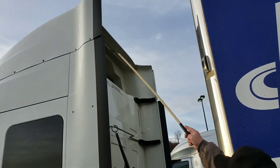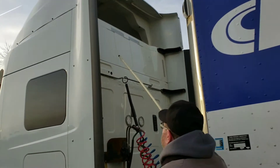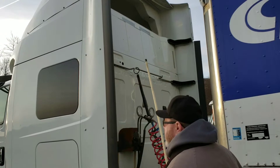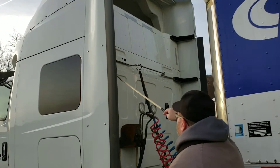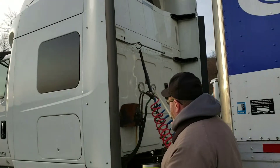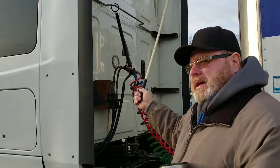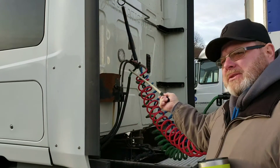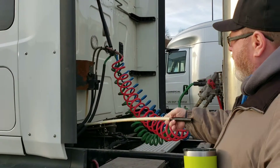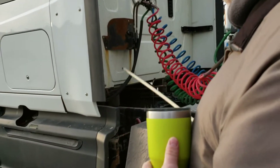You have your air dam up here — you can call it whatever you want, just say top of the truck, it's secured. This is DOT reflective tape — it has to be 50% if it's on the truck. You have your accessory bar going across, used to support the airlines, they're in good shape. These working lights have a switch inside — at night that turns on so you can see while you're connecting your hoses. All your glad hand connections and hoses are not frayed, in good working condition.